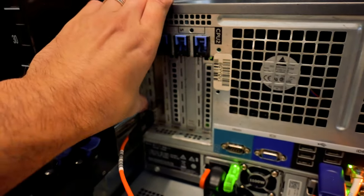This testing is not using RDMA or any offload — we'll have future videos covering those topics, so hit subscribe and ring the bell to get notified. As for whether you need 40 gigabit networking: cards are available cheaply on secondary markets, and cabling costs are almost the same as 10 gigabit cabling, which leads me to believe you should be building 40 gigabit rather than 10 gigabit right now. We've got future videos on distributed storage access over NFS at incredible speeds. Let us know your networking plans in the comments below.